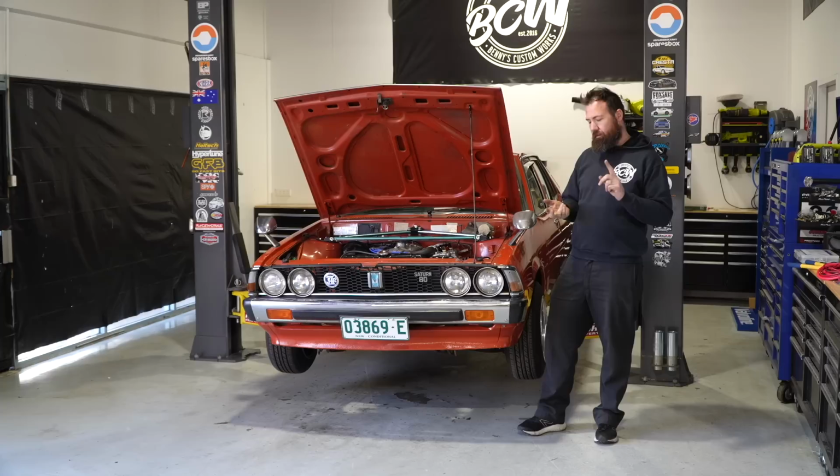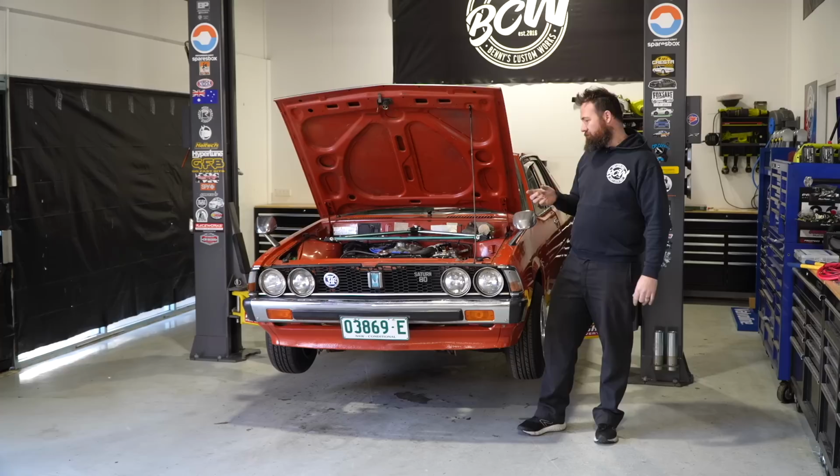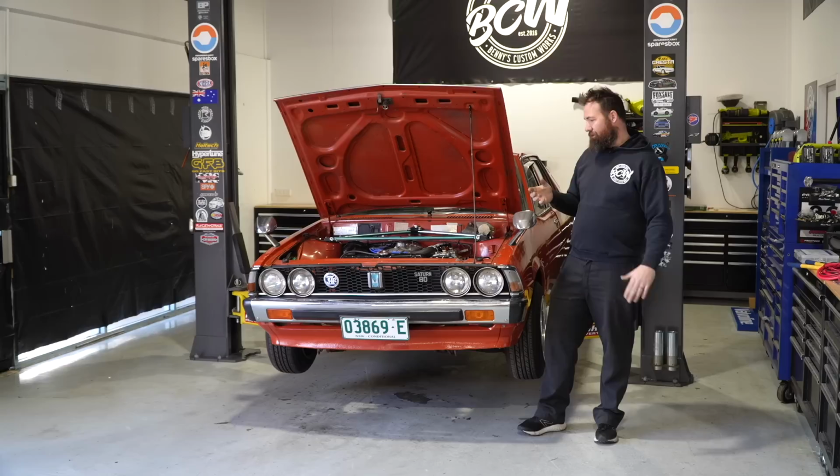I've got the tail shaft. We've got our correct 4.22 rear diff. We're going to be putting that in. We're also going to be filling up all the fluids today. So diff, gearbox, and we're also going to be changing the engine oil because generally when you put an engine together, even a top end, you don't want to be leaving that oil in there for long because it does flush any of the gunk out, any of the cleaning products that you've used. Also, there can be remnants of gasket material and stuff, and that can clog the oil filter. So you definitely don't want to be doing sort of 10 or 15,000 Ks in some instances on the oil that you've used on a freshly assembled engine. So yeah, it is pretty vital to flush all that out. So that's what we're going to be doing today.